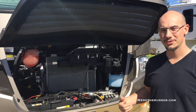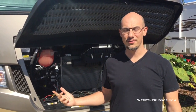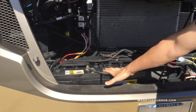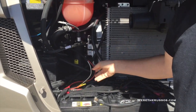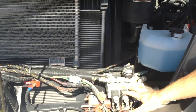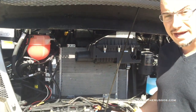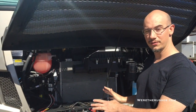This is part two of our walkthrough of the 2015 Newmar Baystar. It's a really nice day and we can go around and show you all the features outside. There are two house batteries — we've upgraded to six-volt rather than the 12-volt that came with it. Here is the solar wiring coming down from the roof. Your oil fill is up here, transmission fluid, and the oil dipstick is here. This is the hydraulic system, windshield wiper fluid, and air intake. Most minor maintenance you can take care of yourself — we're going to upload a video to show how to change the oil for this motorhome.